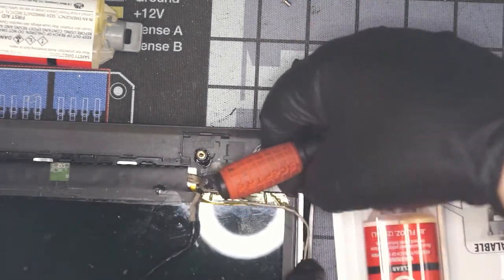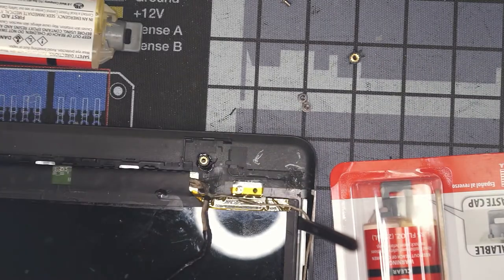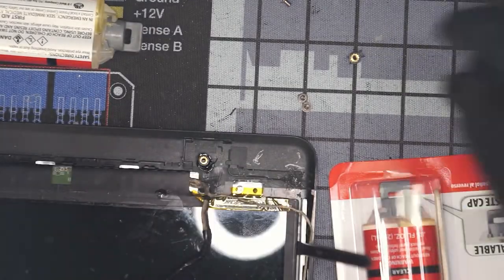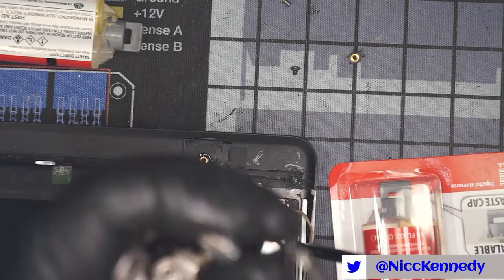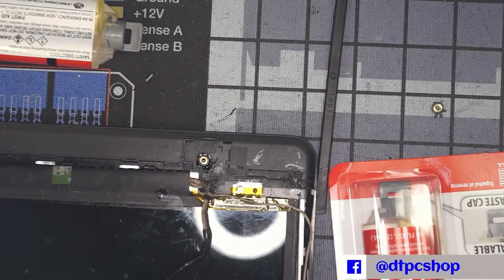I've tried before in the past super gluing some of these little things that I cut out of other laptop lids. If the camera finds where we're actually at here, I've tried super gluing these in and it never seemed to work too successfully. So we're going to use some epoxy and build it up around it as quick set. Right now we're going to put these on little tiny pieces of plastic. That one on, looking good. We need the top hole here.